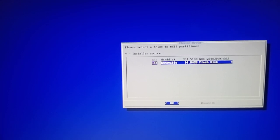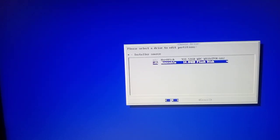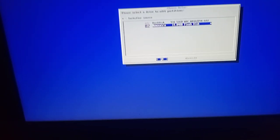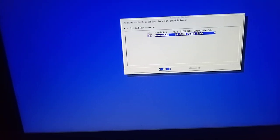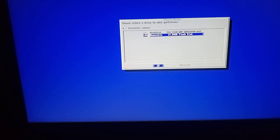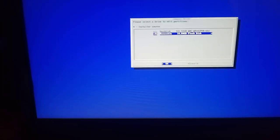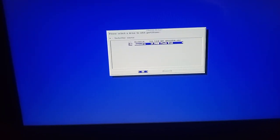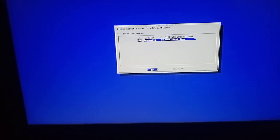Okay, so your other option is actually get a different removable USB, put that on the other side, and of course that will show up here. And then what you want to do is actually install this system, because this is the installer drive. I mean, you can run straight from it if you just want to run a virtual sort of thing, but if you want it set up permanently, of course you can make yourself a portable USB that you can plug into anybody's computer. So you have a removable device show up, click on that, and it will actually install it to your removable device. So get yourself at least a minimum 16 GB.